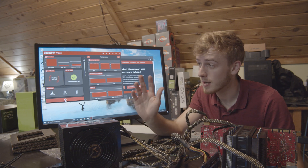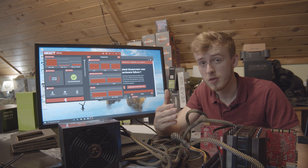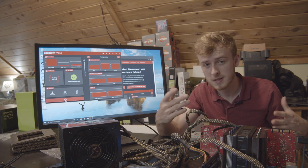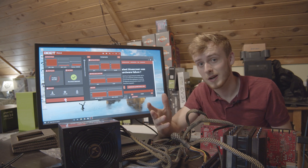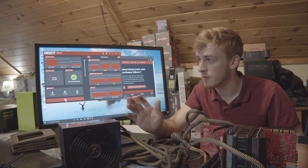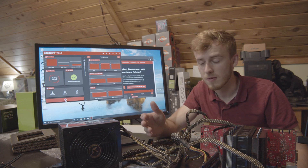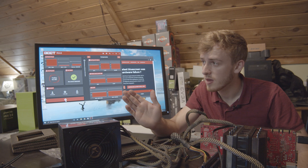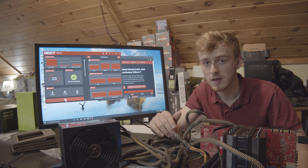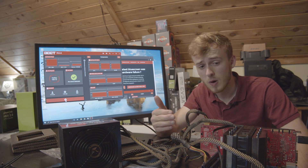With this installed, it's averaging right around 47 degrees Celsius. A couple things to point out: number one, this is actually relatively loud. I've got a laptop over here that's just about as loud, and this is a desktop cooler. I really think the fan is a little loud. This is around 47-48 degrees — roughly 25 degrees less than the 70 we saw with the stock cooler. So this is definitely running substantially cooler, but it is quite loud.